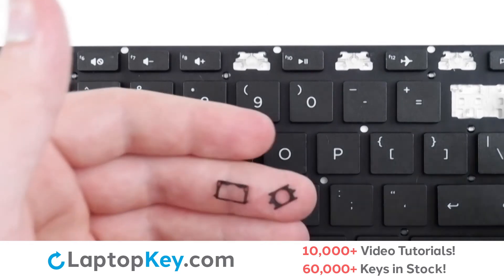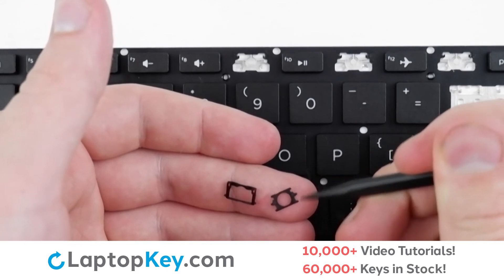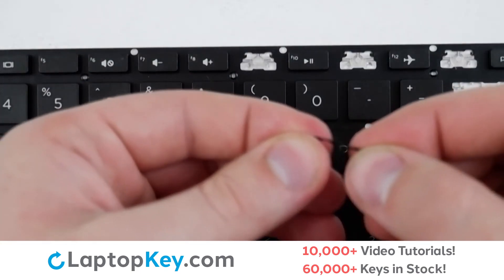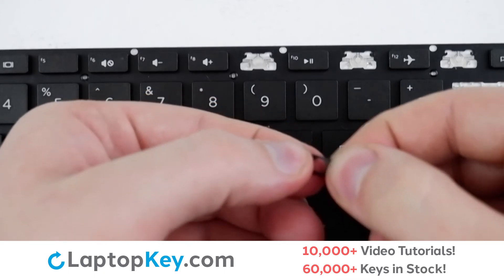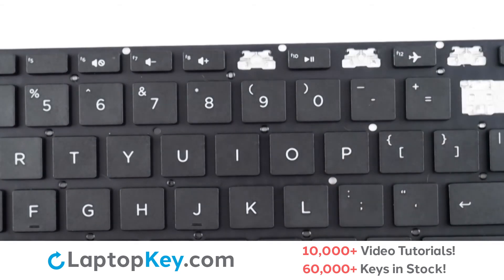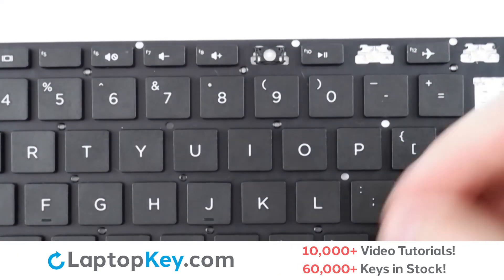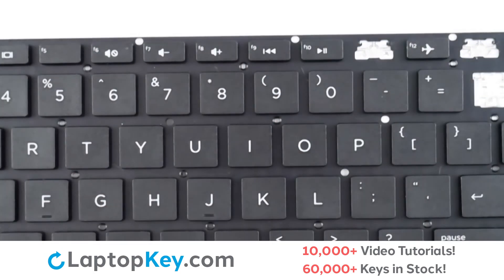To reassemble your clips, we'll begin with the top clip which has two arms in the middle, with the actual connector piece being slightly more towards the bottom of the clip. For the bottom clip, there are two holes as well as a small rounded notch at the top. Simply line the two up, connect together, inserting the arms of the top clip into the holes on the bottom. Then, using the metal hooks, you will lay the clip down, bottom first, hook on, firm press to the top, replace your keycap, firm press, and we're functional.